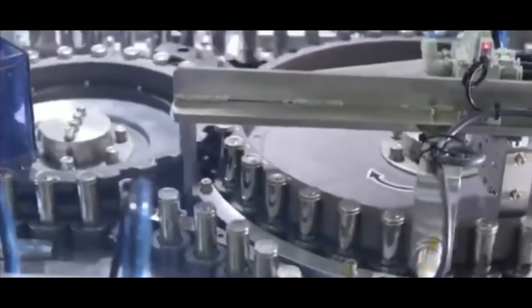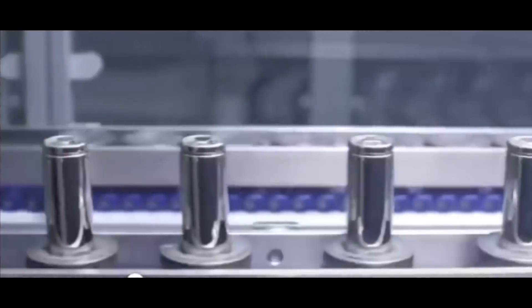The cylindrical cell has less battery per cell and needs an aluminum casing, so there's extra weight that isn't actually being used for the battery. But cylindrical cells handle expanding and shrinking under charging and discharging much better. Prismatic batteries, on the other hand, require extra hardware to accommodate expansion and contraction during charging and discharging. Really, it's mostly a question of picking one or the other and having a plan, because whatever you decide, the next key is to mass-produce them at huge volume to bring costs down.